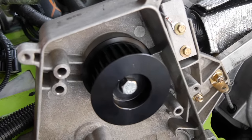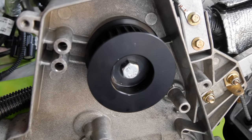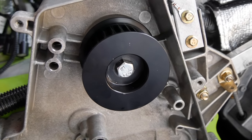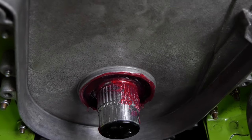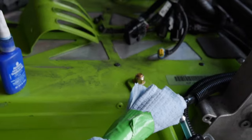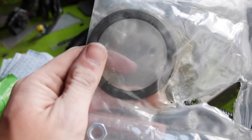Once you get the bearing on, you can slip your top gear on. That bolt is supposed to be torqued to 20 foot pounds — there's supposed to be a washer there. I can't find one in my kit, so I'll just run to the hardware store later. You're going to want to grease the lower bearing, and then once you get it all greased up, you're going to take the seal that comes with it and seal that bearing up.